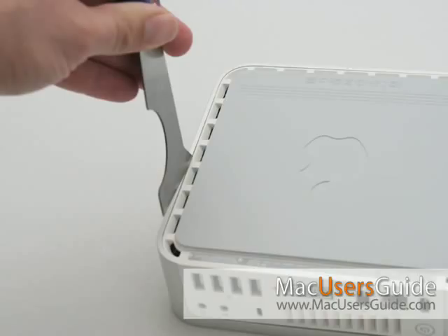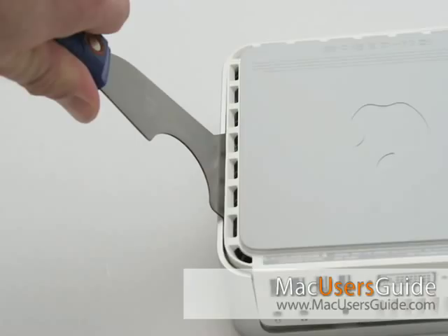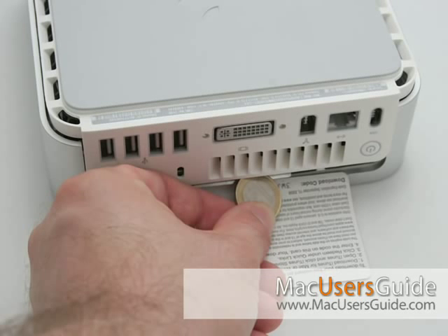Place the computer on a clean, flat surface, and turn the computer over so the ports are facing up at the bottom of the computer. To avoid scratching or denting the case, use caution when using the putty knife. Hold the putty knife preferably in your more dominant hand, and find the gap on the left side of the computer. Basically put the putty knife between the metal and the plastic bottom piece. Gently pry, and you'll hear some clicking and popping sounds — those are the internal latches popping loose, removing the top housing from the bottom. Repeat the procedure on the right side. I found it very difficult to do that, so I used a different technique.